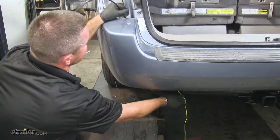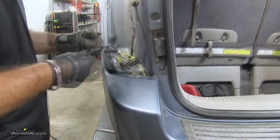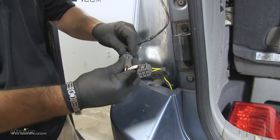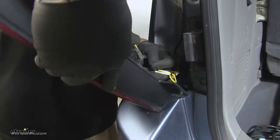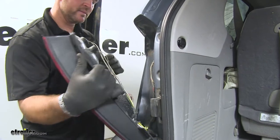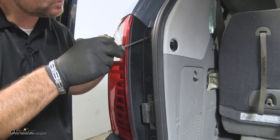I'm going to slowly pull it back up through here. Once you get your path there, pull your wires out and remove the wiring from the airline tube. We're going to match the ends and push it until you hear it click. Now we can reinstall our tail light — push it until you hear it click, making sure that you line up the pins with the holes on the side as you're putting it in. Now we can reinstall our screws.